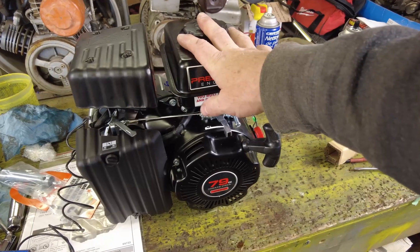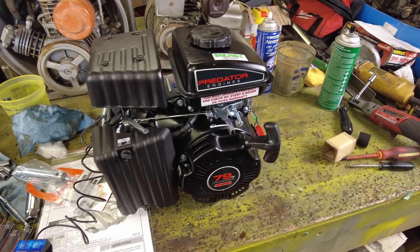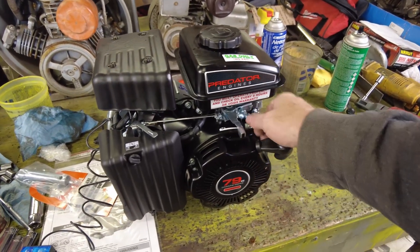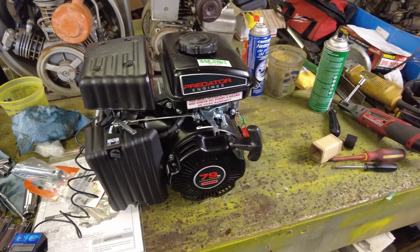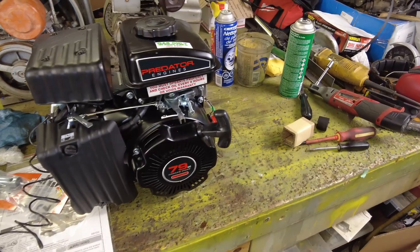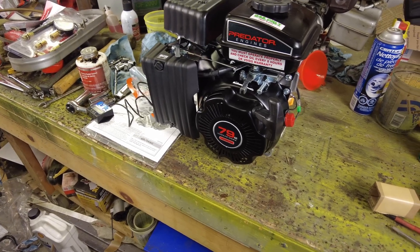We're basically ready to fire this thing up. It's got oil in it. Put a couple of cups of gas in it — I don't want to get too carried away. This doesn't have a fuel shutoff on it, so there's no way to run the carb dry other than to open the drain. Our throttle is up off idle, I haven't played with the max setting screw yet, so who knows how high up this is going to rev. Choke is set to the run position. I don't have any screws on this thing, so we might have to shut it down — over here on the side of the engine is the kill switch. Let me set you guys up and we'll give this thing a try.